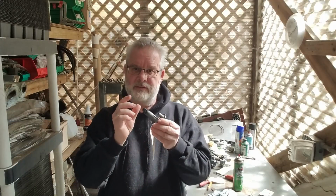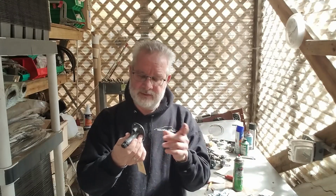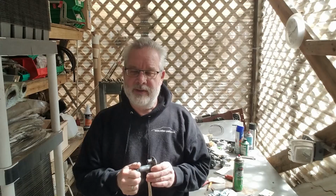The last thing I'm going to try to do, and I have already found out it's not as easy as I thought, is a troubleshooting chart. Just starting: do you have resistance? Yes, no. Or do you have a defined resistance? So you have either tens of ohms or you have infinite ohm or something in the mega ohm, kilo ohm range. So then, yes, go further down, check the air gap at room temperature. No, go and clean the contacts, that sort of thing. But at the moment it's a bit messy. I hope to clean it up to give you a logical and relatively easy to follow troubleshooting chart to do the repair on one of these.